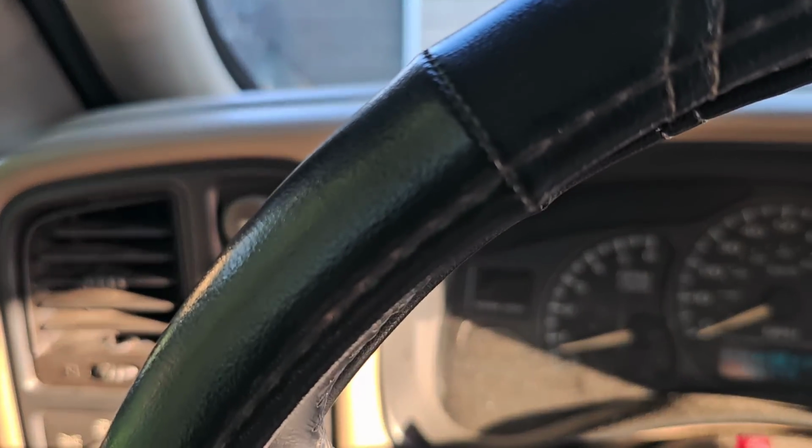So hub and bearing for one video, and that's an hour-long video, and then this wheel speed sensor. So that's all said and good. Believe it or not, because this has auto 4-wheel drive, I've seen auto 4-wheel drive get affected by inaccurate wheel speed sensor readings. So just something to think about. All right, that's pretty much it. Hopefully you got something out of that. I always learn a little something when I'm doing something like that.